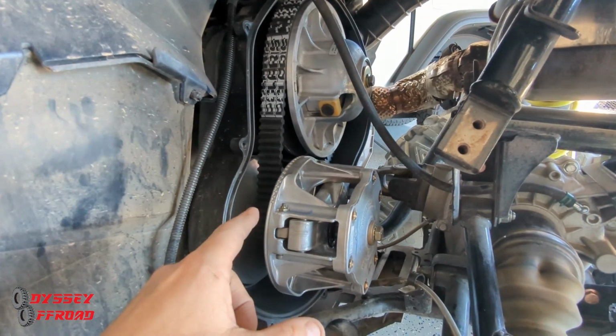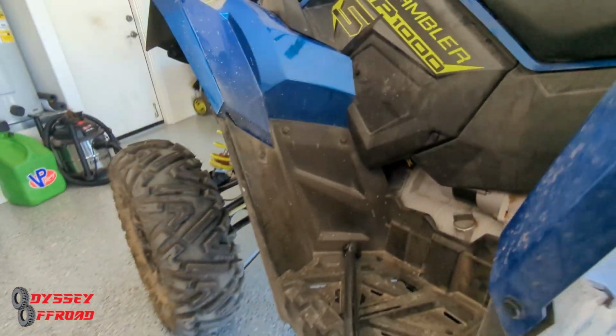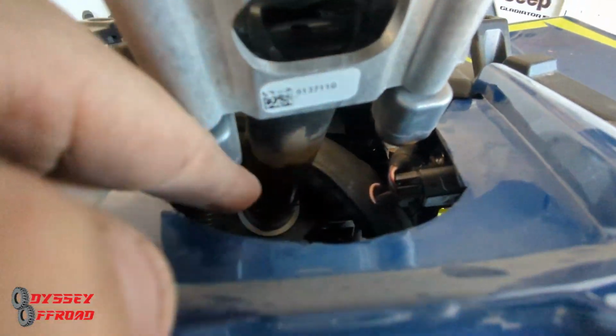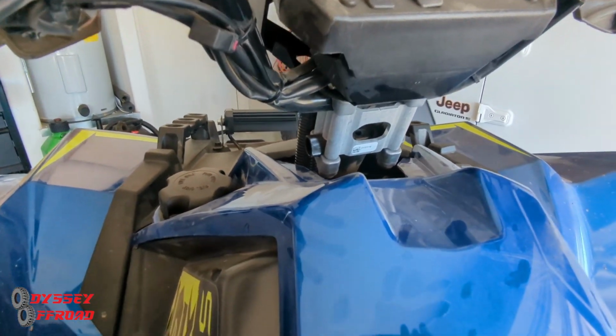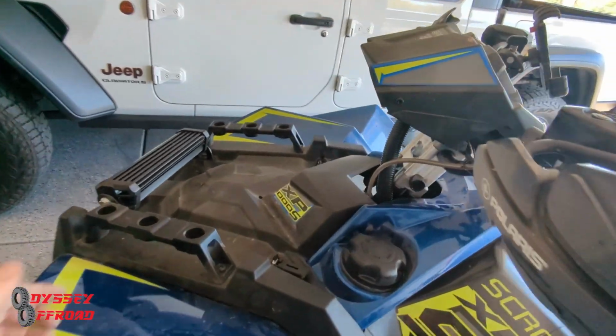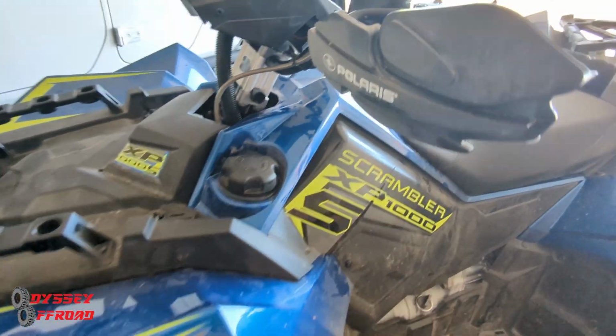Today, besides this, I was working on the steering stem. I put a steering stem stabilizer bushing in it from J Parts. You can see it down there. A steering stem bushing. Stock one is junk. You could literally see the steering shaft moving in the stock bushing. It was worn out already, and this machine's got about 820 miles on it. And it was shot already.